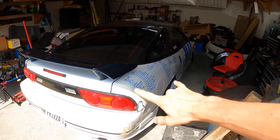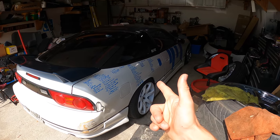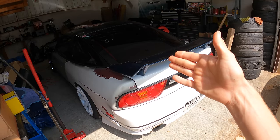so congrats guys. And I also secured a ticket to Rio Bash, so that means September 23rd and 24th, I will be back at US Air drifting the S13. Right now I only have a Saturday ticket, but I'm going to be looking for a Sunday as well, and we have some maintenance to do on the car as well. So I need to start making an additional list for a drift prep. And also I want to add an oil cooler or something because I hot lap. I'm the guy that's out there all day just getting laps in and seat time. And RBs are known to have oiling issues, and I really don't want my RB to blow up, so we're gonna prevent that from happening.